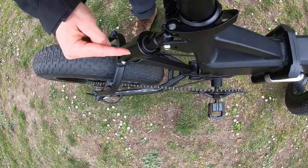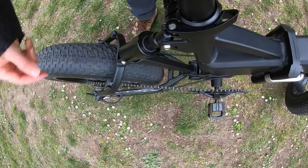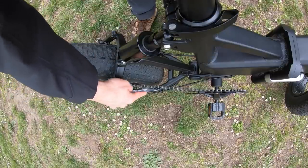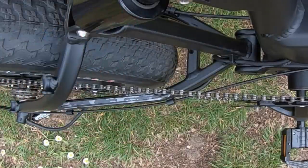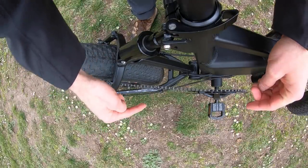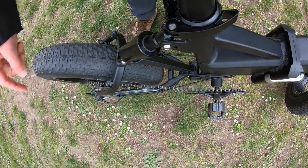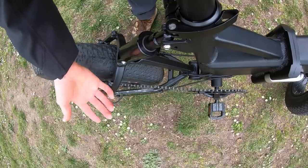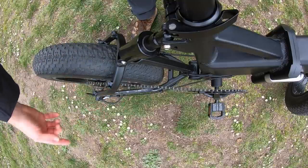From here you can see that rear suspension and how much actual travel it gives you. Going to do some off-road riding — there's that 54-tooth steel chain ring up front with the alloy guard and plastic slap guard, which looks like it could be stuck down a little better. I can see the chain's touching slightly already. The 14-to-28 rear freewheel again. This is a longer frame because of the rear suspension, which makes the wheelbase longer. They're using thicker 12-gauge spokes in the rear for extra strength in a 32-hole pattern, and 13-gauge spokes in the 36-hole front rim.